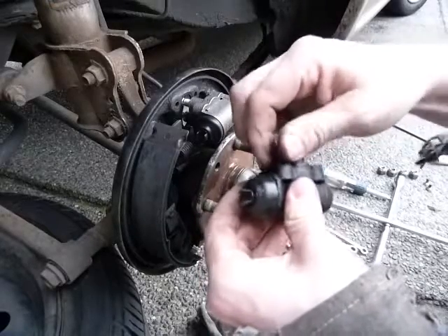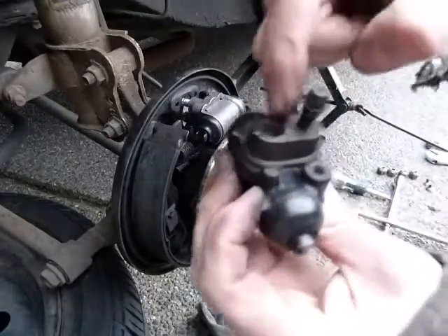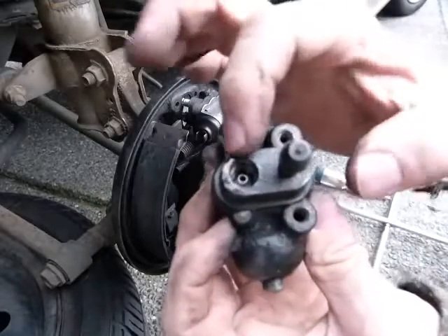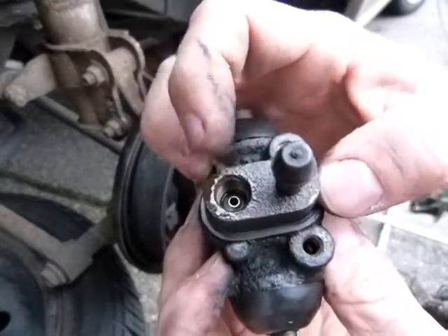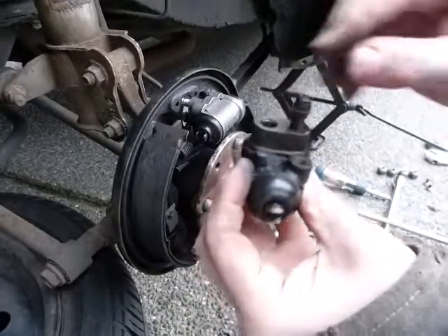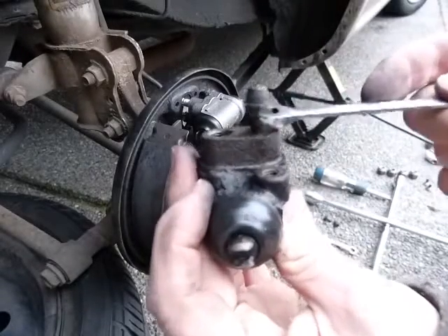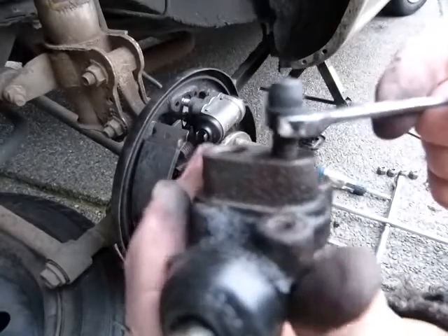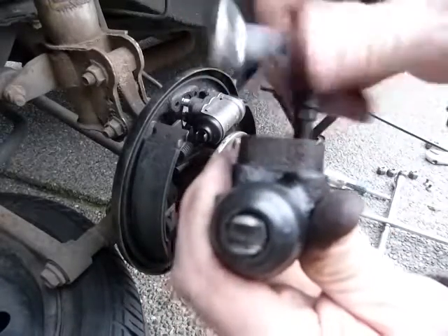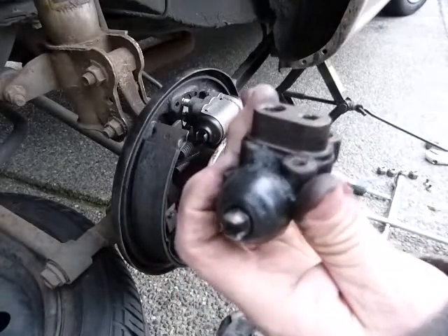Okay, I'm gonna take this one out and that one out. There's one more thing that's mounted there — the brake line. The brake line has the brake fluid in it. You can see it's still moist, leaking some brake fluid, because there's still some in the chamber inside. Next thing I did — this is the bleeder valve. I removed the bleeder valve. You put the 8mm wrench on it, or the pipe wrench, whichever you like, and just remove the bleeder valve. The reason why I removed the bleeder is because it was in the way — I couldn't get the 10mm wrench on the brake line below and couldn't turn it.